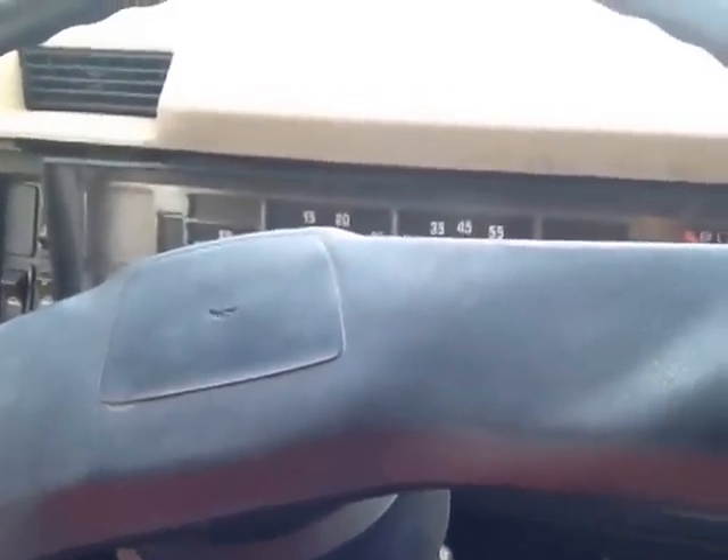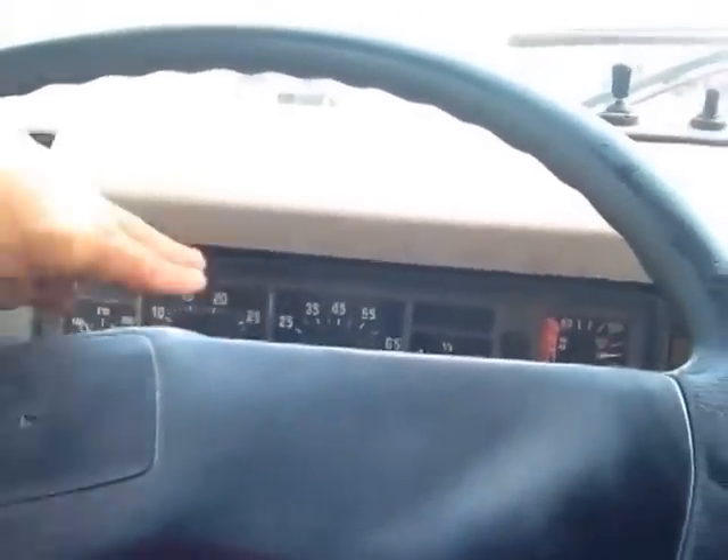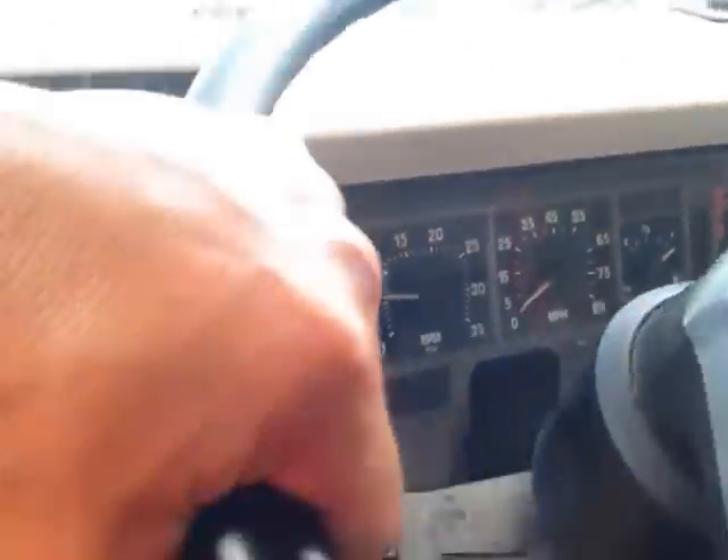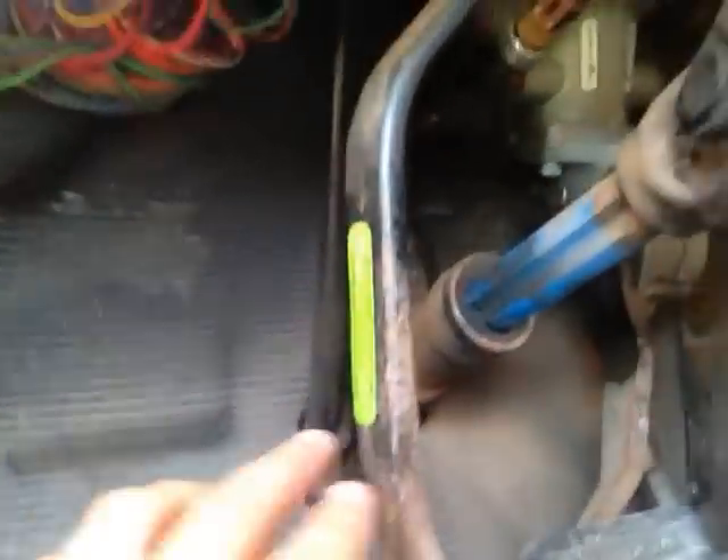You can downshift with the engine brake on because as you're stopping and moving slower and slower, you can catch another lower gear. It's designed so you can shift with the engine brake on. Down below here you've got your clutch, and you see this switch up here? When you push on the clutch, it disengages or shuts off the engine brake just in the free play of the clutch — you don't have to push it so the throwout bearing releases, just enough. While the RPMs are up, if I'm off the throttle, it'll turn off the engine brake so I can do my double clutch to shift.